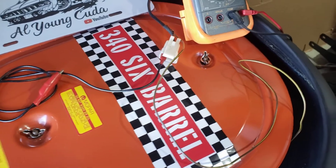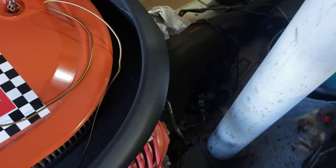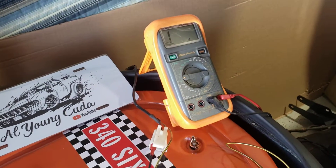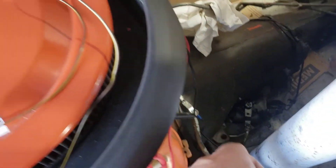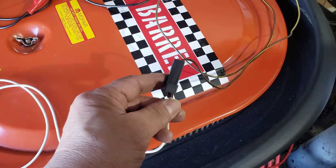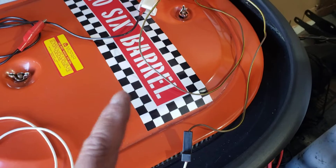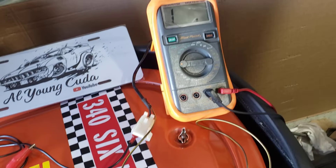What we're going to do here is check it with an ohm meter. I've got a reproduction harness going to a transmission that I have sitting over here and it's plugged in. I'm going to work the lever over there — I've got this hooked up to an ohm meter. Right now it's grounded to the transmission, and I'm going to tap the other wire into this one. This is the one that goes to your relay, so it's looking for a ground only in park and neutral. I put it on sound so I don't have to keep moving the camera back and forth.